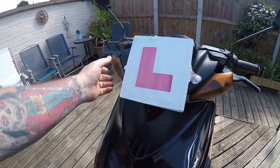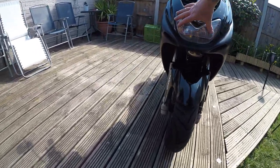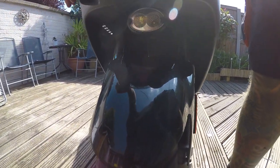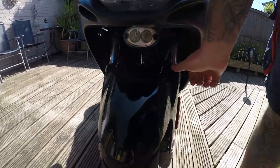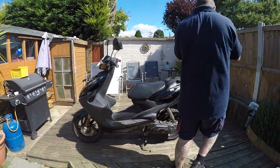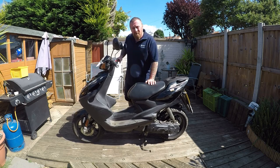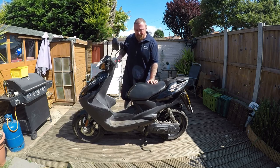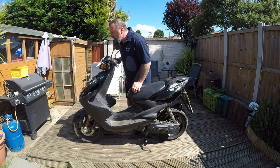I don't like this - it's going to come off. Not sure what caused the damage here but the lights aren't bright. Never loved the lights on these - you can see the bulbs there, it's not the best. Front shocks on these do go but these haven't gone, which is good. It's another really hot day - this needs MOTing. The rear shock's gone, front shocks are right. All the lights and all the panels have to be secure, otherwise it will fail the MOT. So it has to be completely gone over. And here we go - two keys, all the paperwork.